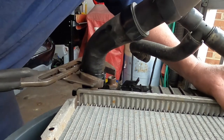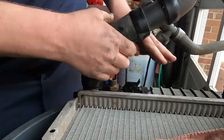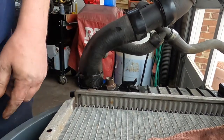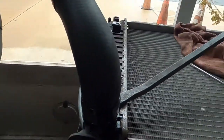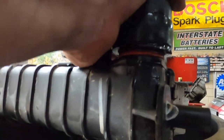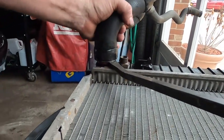Okay, it's turning. It says to turn 45 degrees but I saw some other videos where it said you've got to turn almost 90 degrees. I got it turned and now it should pop off, but it's not. What happened is I put the big pair of channel locks on the hose up here, but the hose is actually spinning on the metal piece. You have to put your channel locks down on the metal piece to grab it and rotate it. The tab is now here when it was there, and now I have my big screwdriver underneath it to pop it off.